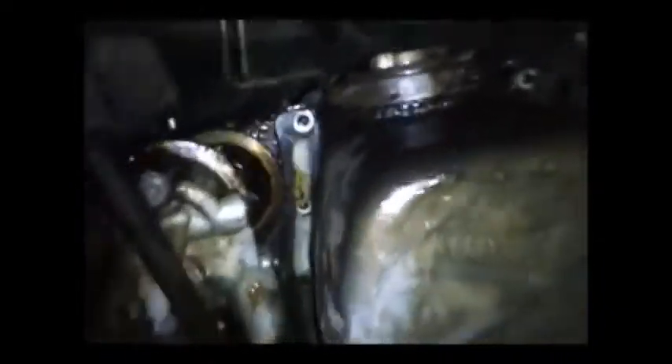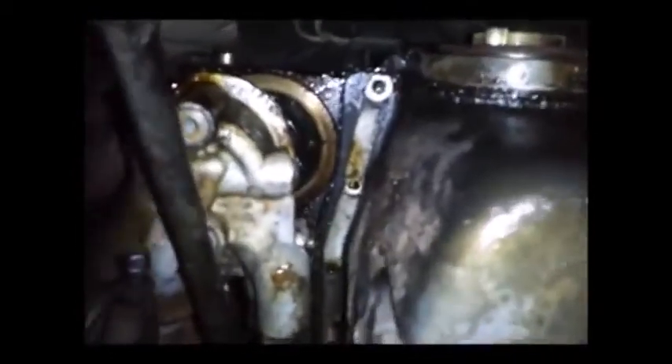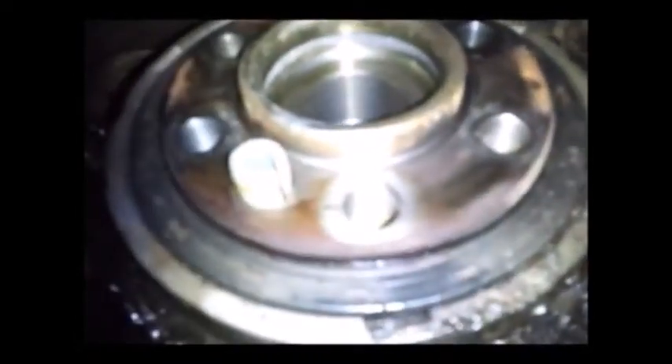Like I said, I wasn't planning on replacing the oil pan gasket. After looking today, I realized it really wasn't leaking, because all of this oil here is from the rear main seal - everything up here is pretty much dry. So the oil pan gasket is not leaking. But this bolt here goes up into the rear main seal housing, so I can't get it out because the rear main seal has to slide off the crankshaft first. So it looks like I'm going to have to drop the oil pan down anyway, and I'll go ahead and replace the oil pan gasket while I'm at it.